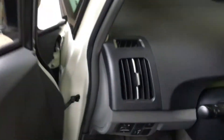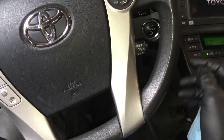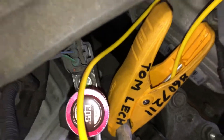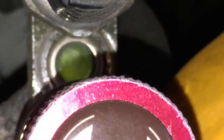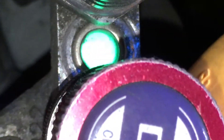Now let me show you some bubbles we can see with the UV light. Some people will want to see what the UV light looks like in the sight glass when the refrigerant level is really really low. You can see the gas and the liquid — that's what it looks like when there's UV light shining on it.